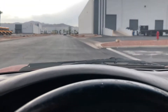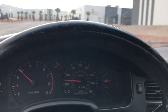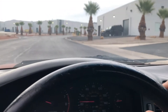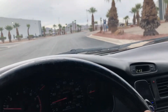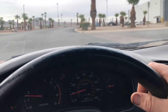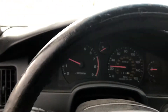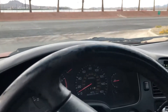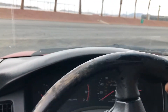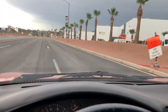This is DJ coming at you live from High Impact Motorsports. I just finished up the MR2 — did a timing belt, water pump, and the coolant hose from hell. It's called that because the coolant hose is part of the oil cooler assembly, so you've got to remove the whole turbo manifold, the cat, and the exhaust manifold. On top of all that, the valve cover gasket was leaking pretty bad — barely any gasket left. This engine was definitely covered in oil.